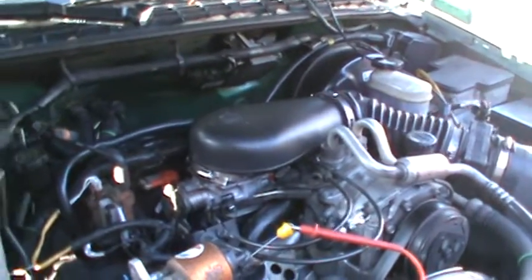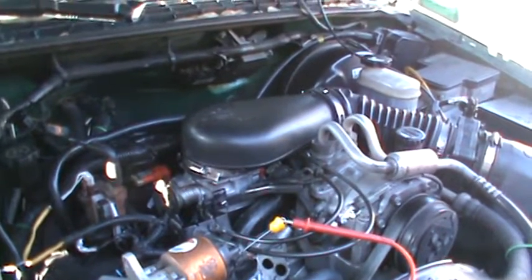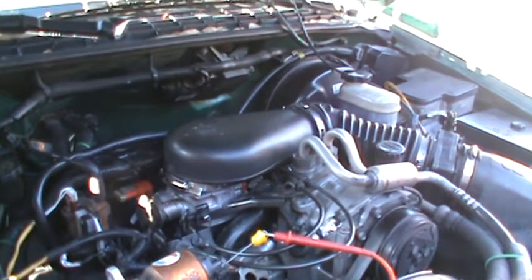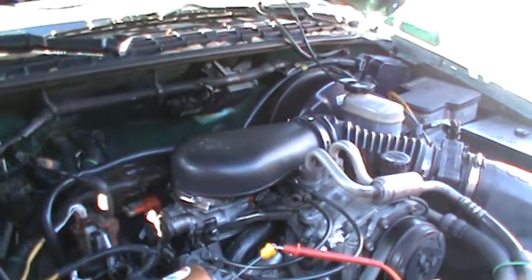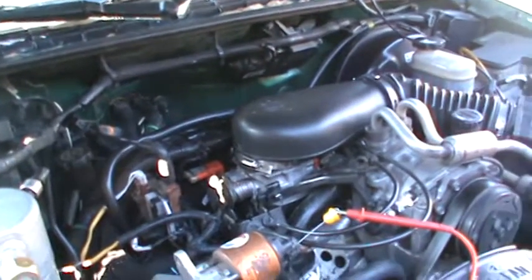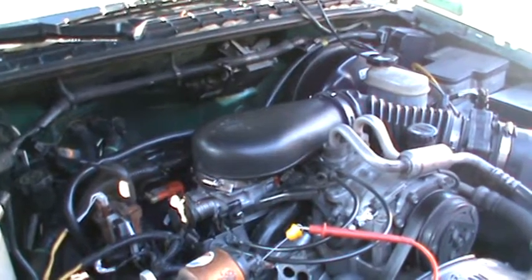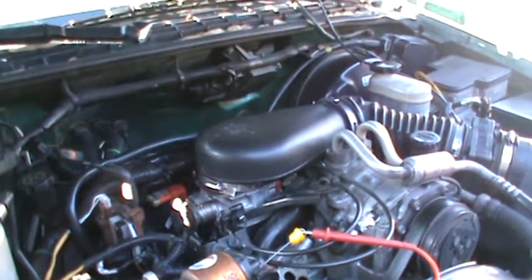Now the distributor cap on this thing, these things are really sensitive for some reason on this crossfire system that they have on this vehicle. I don't like the design. I wish they'd left the old school design alone. It was fine, it wasn't broke, but they decided they needed to fix it. So there are a lot of issues with that. I recommend using an ACCEL distributor cap and rotor button.